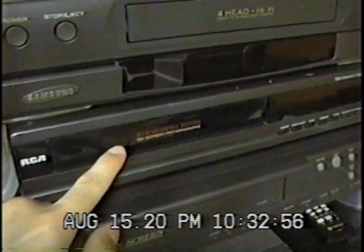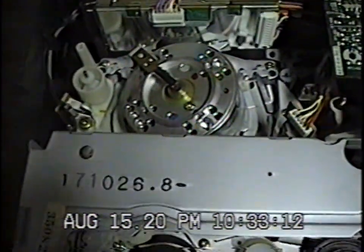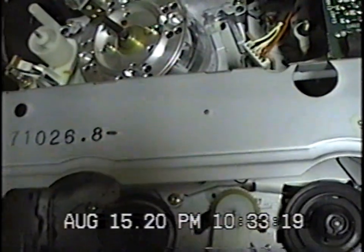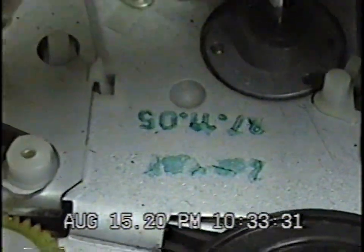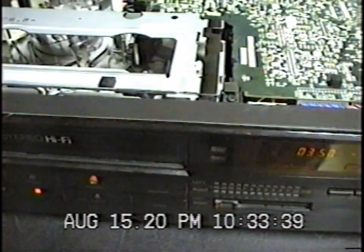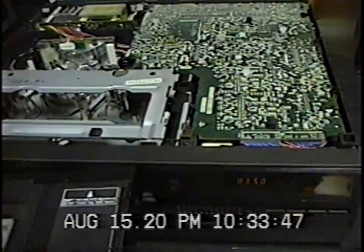This VCR has this mechanism built a little later than that one, and it's more basic — you can see all the buttons it has on the front. That other one is a four-head mono. Here you can see the drum with two video heads and two Hi-Fi audio heads. There appears to be a date code here that reads '87 11 05,' which would mean this VCR was manufactured in November 1987 — I thought it was a little later, but it makes sense.